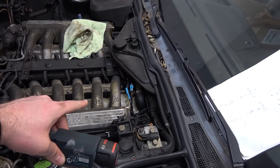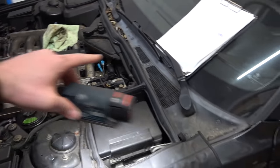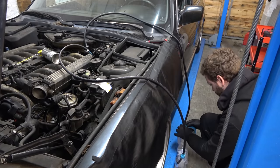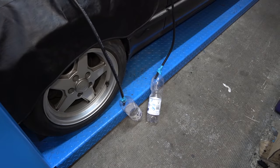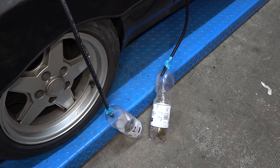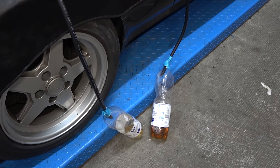If you're doing that monkey stunt where you're standing over the engine, never lean your hand onto the intake manifolds because the gasket can break the seal and then you'll have vacuum leaks. Now we're going to connect the fuel hose around the fuel pumps manually and remove whatever old fuel is in those lines. I'm going to fire off the fuel pumps. Is there anything coming out? Yes. If that looks like insufficient fuel pressure, you're about to find out why.